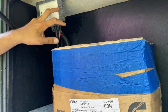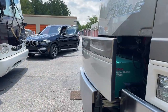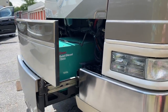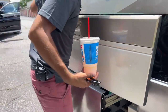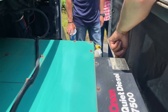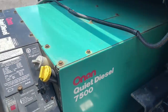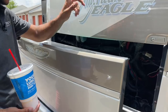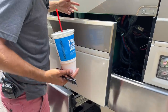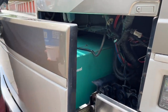This is for the generator slide — it's a little hydraulic pump for it. You press it and it slides out. Hydraulic is better than electric for something this heavy. Now this is the oil and this is the coolant. That light will give you a code — level-one codes are flashes one through nine. It'll pause and then flash again to give you two digits, and you can look up exactly what's going on online.